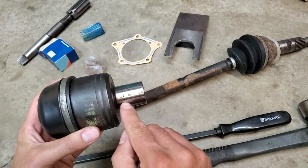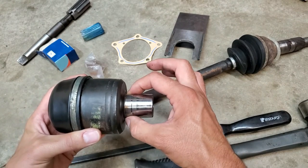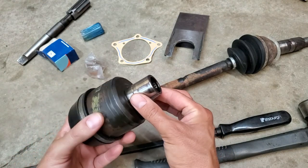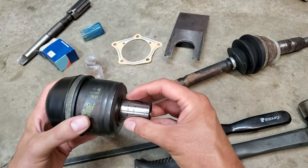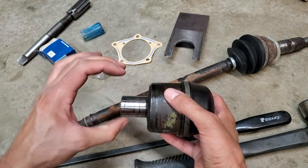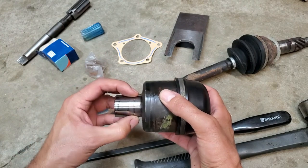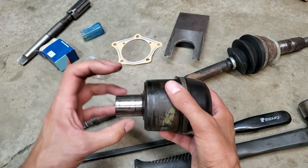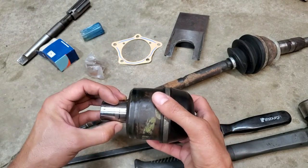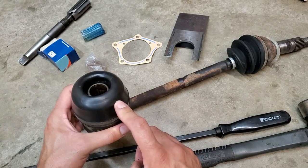On that green car the joint was good and the bearing wasn't too worn out, so it was just the rubber seal that had failed. I typically find the right hand side of the pot joint assembly to be the one that fails more often. I suspect it's because of exhaust heat, since the exhaust runs right in front of it and might just kill those seals prematurely. I also noticed that the inner boot was torn and went ahead and replaced it while doing the seal replacement.